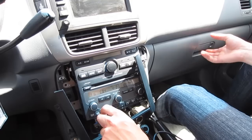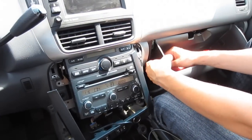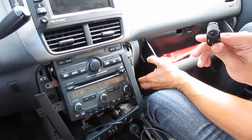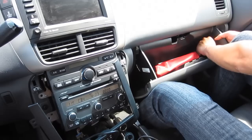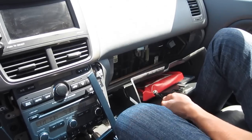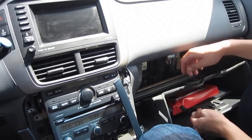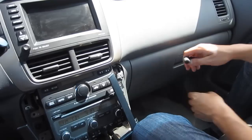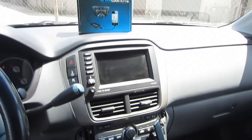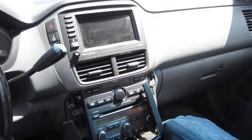The next step is to feed the cable. As I said earlier, you can feed it to this panel by drilling a hole, or you can feed it to the glove box. This glove box has these stoppers here which you can remove — they just unclip. Same on this side, you just remove it, and once you remove them the glove box drops and now you can easily feed the cable out to the glove box. Then just put the stoppers back, and that's pretty much it. I hope you liked the video — this was a video for GTA Car Kit and the 2006 Honda Pilot with navigation. Thanks for watching, we'll see you next time.